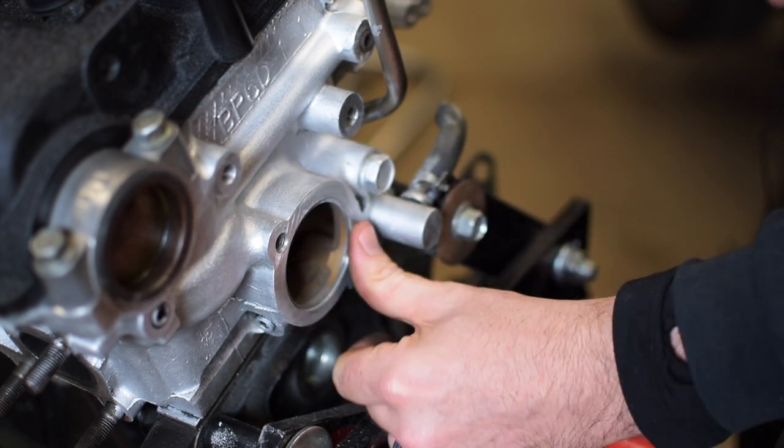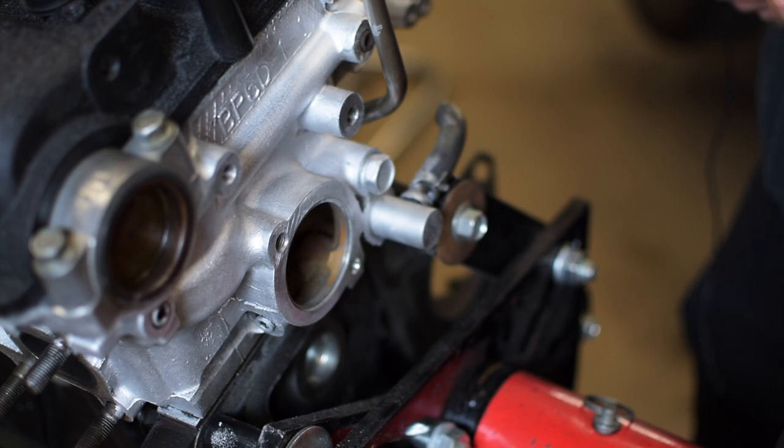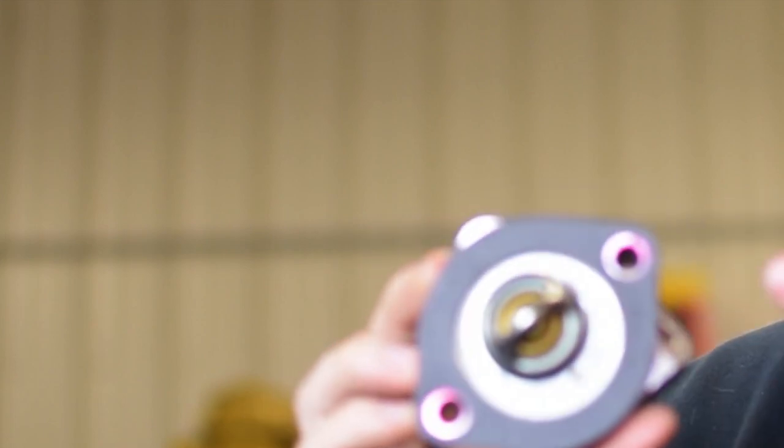You want to clean this up — make sure there's no gasket material left before we start installing the rest of the parts. The first step, once you've removed everything, is to put on this rear assembly. This is the spacer neck that goes on the back of the block and gives enough space for a thermostat to fit inside that housing. I've already put the gaskets on front and rear — since they're adhesive, it actually kind of traps the thermostat in, which is really nice. I've also sprayed these with some copper tack spray, which I use on pretty much every gasket I put in a car.